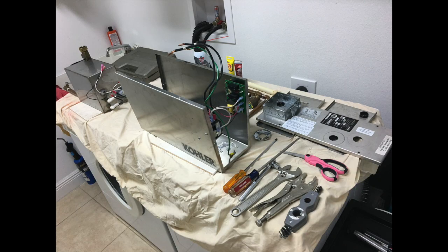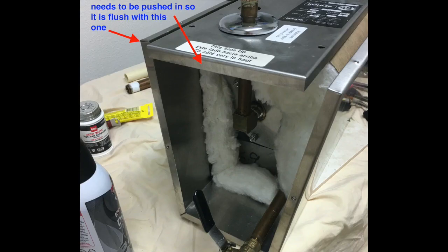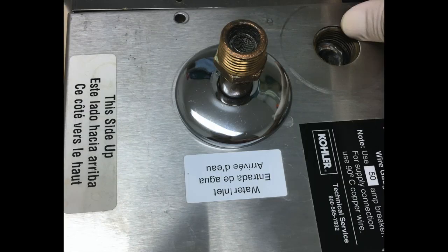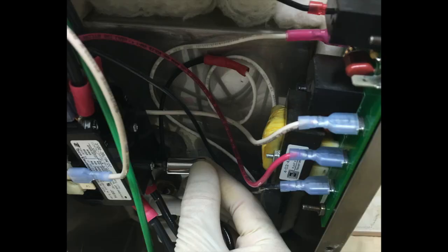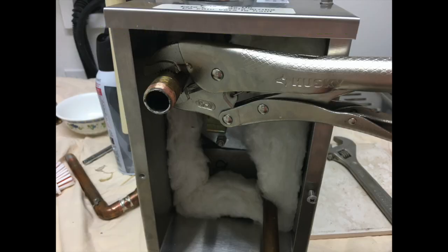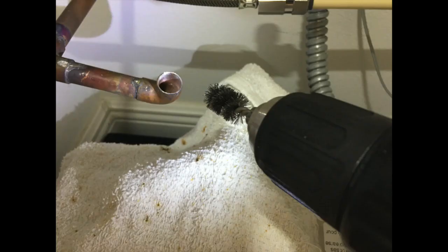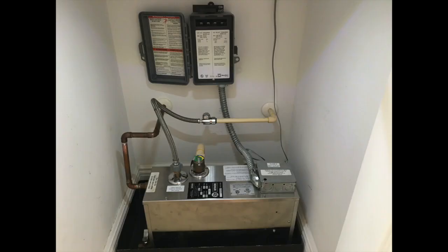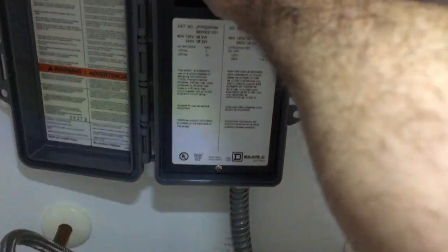Then it was time to put it all back together. I started with the foam, cradled the steam unit and inserted it — you have to make sure everything's flush. Here's the steam head unit. Then I pipe-threaded this pipe with blue Teflon tape and put the 240-volt connections. Unfortunately I rushed and put the pipe in before the front panel, so I had to remove part of that pipe, put the front panel on, and then put the pipe back. Here's the assembled unit — I cleaned the two pipes really well and soldered them together.